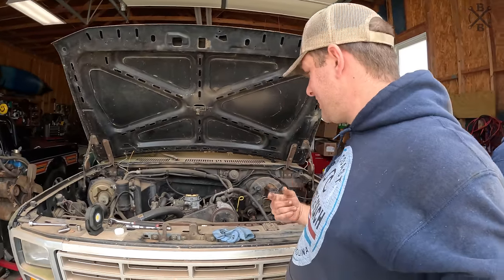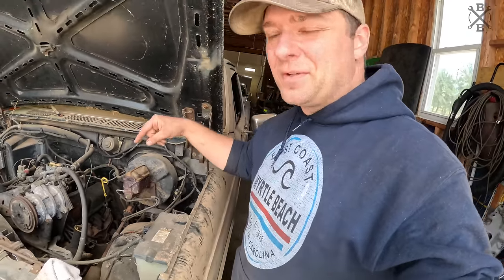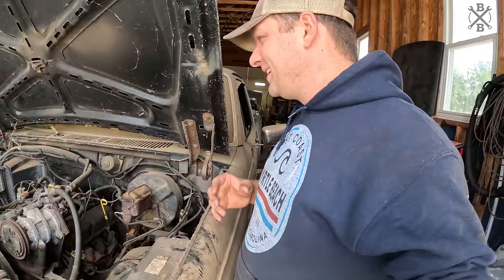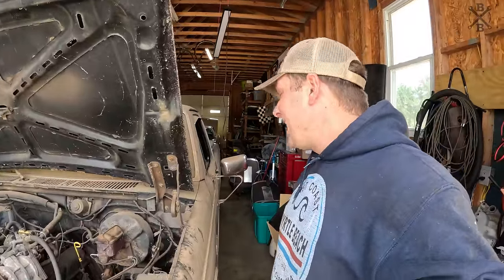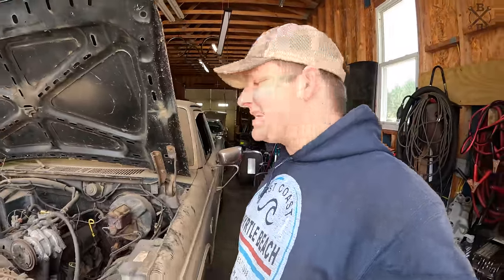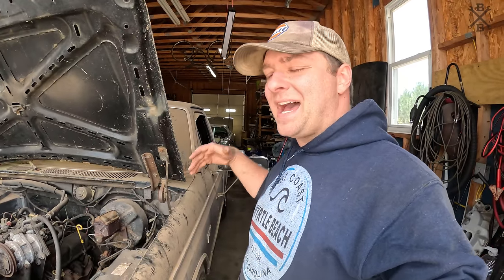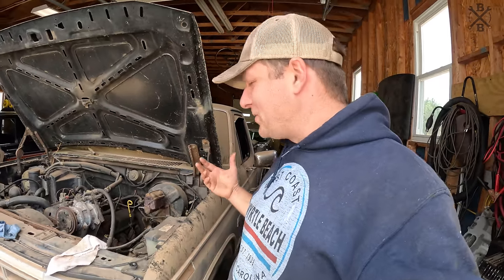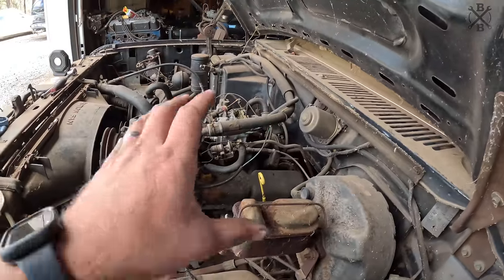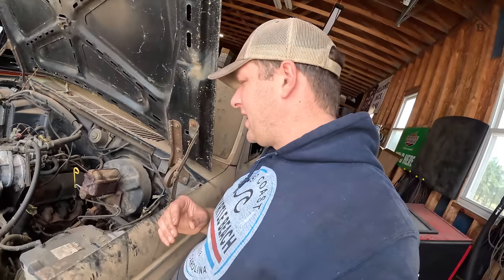Before we go ahead and start turning this thing over with the battery, I do want to disconnect the fuel line down here from that fuel pump, because being this thing's in the garage now instead of out in the open, I mean, you just smell the stanky gas aroma from it. I have a feeling we're probably gonna have to drop and clean the tank, which what we may do, I noticed a little bit of rot in the bed. We may pull the bed so we can repair that. And while we have that out, we'll clean the tank and everything. So we will be running this, of course, off of our boat tank. With that being said, if there's not a ton of crap in the carburetor, I don't wanna start flowing it up into the carburetor.